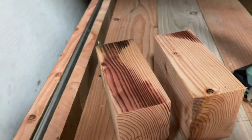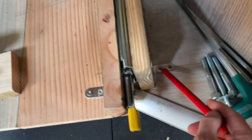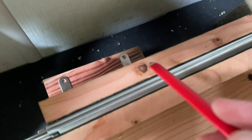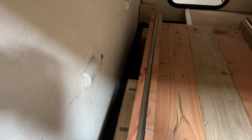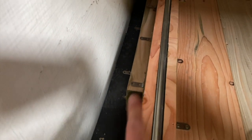You'll have noticed the difference in floor height between the two sides. I've got two small blocks, one going to each end, and a longer block sliding into the middle. I'm attaching those with angle brackets, working out where the brackets will go to attach the sides of the drawer slides to the van. I've fitted the brackets on one side and bolted the blocks of wood to the floor on the other side — apart from the middle one which I can do now — then it's a case of bolting down on this side as well.